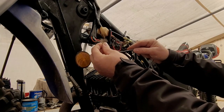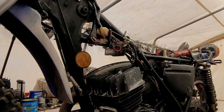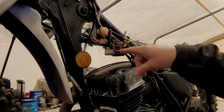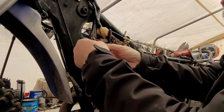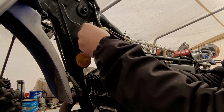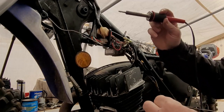Take the same gauge, bring that right over here, give myself a little extra. I don't like using connectors because if you have to make extra-long jumper leads like we have to here, you'd have four butt connectors to deal with. There are two different ways of doing this: you could solder the ends and touch them together like so, or you can twist them together. I'm going to use the twist technique and solder. You can see how they're twisted together like that.